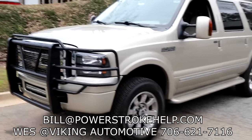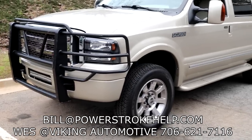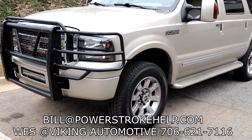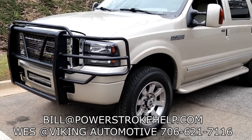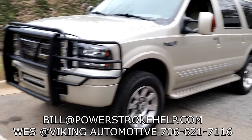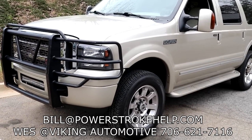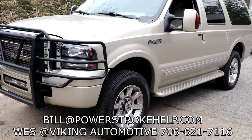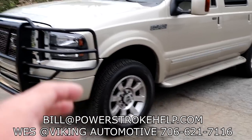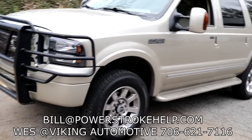We had to go with a blue top steering box — started with a red top, went to a blue top — and we've done some front end pieces. COVID seemed to really affect the quality of some parts we've gotten. Ball joints and tie rod ends from Ford seemed to drop in quality. We were exploring the Kryptonite brand; we have a couple Kryptonite parts on the front and an N-link bushing on the track bar. After a couple of those and different sets of wheels, he would go down the road and it would settle into this harmonic in the front end.